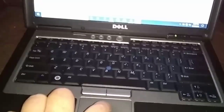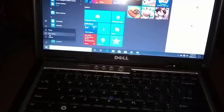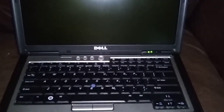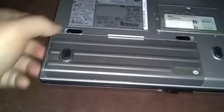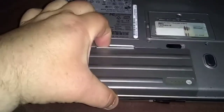We've got to shut down. Turn your laptop over — we're going to remove the battery. You want to pull these two clips outward away from each other. There's a primary battery right here. Pull it slightly towards you and then lift it up.